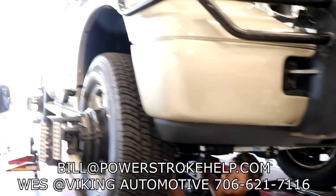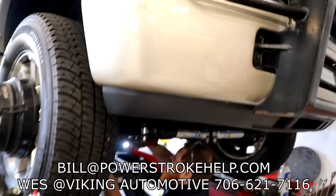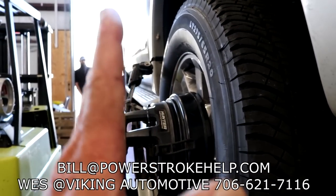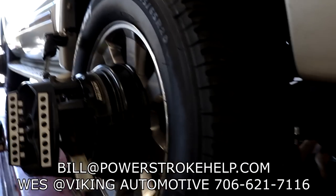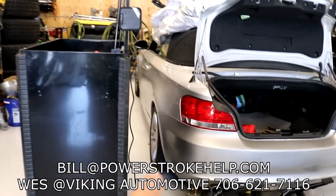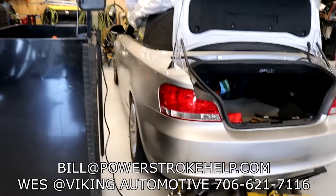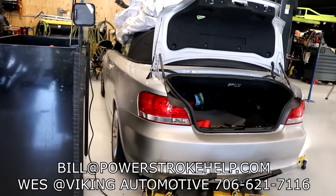This is the best-driving Excursion I've ever driven, and I've driven a ton of them. For those who don't understand — camber is the way the top of the tire leans in. On a BMW you see a lot of negative camber on the rear wheels because of the independent suspension; the camber helps the car turn, which is one reason why these cars handle so well. On this twin-beam axle, you really can't change the camber split independently.